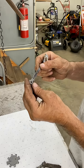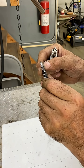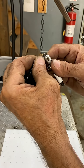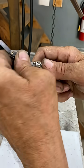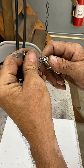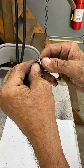So how these tools work — they've got the different thousandths of an inch on here. This one's 30 thousandths. You try to stick it in there, and if it doesn't fit, that's what this part of the tool is for, for bending this little tang. And you bend it until you can get the proper feeler gauge amount you're looking for to fit in there.